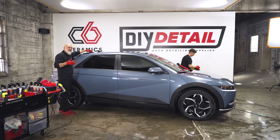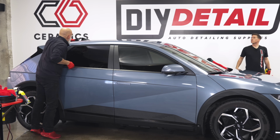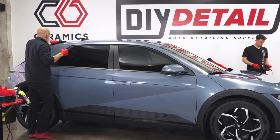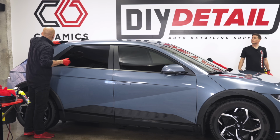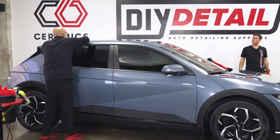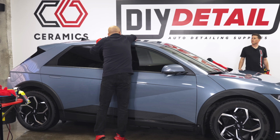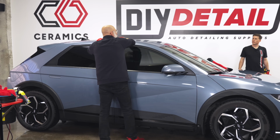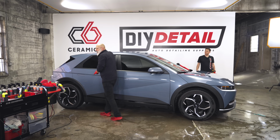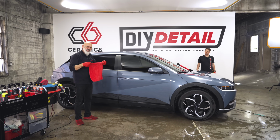I'm using a rinseless dampened towel, low nap, to help remove the polish. I don't want to be applying pressure when I'm removing the polish because we just finished polishing this paint. We're trying to make it look better, not worse. And pressure never helps. So by using the rinseless dampened towel, it breaks down the polish residue, lifting it off effortlessly, leaving a bit of lubrication behind that comes away with the towel. Now, those detailers out there that are really keen on overthinking stuff, our rinseless wash doesn't leave anything on the surface once you wipe it away. So we're not hindering the performance of the coating in any way, shape, or form.